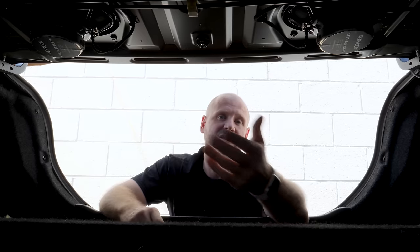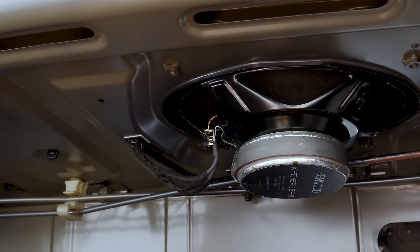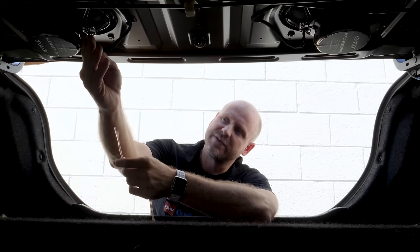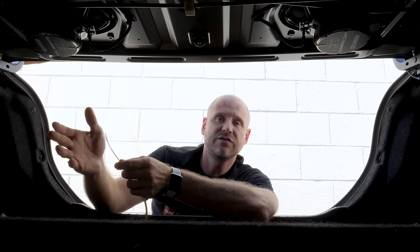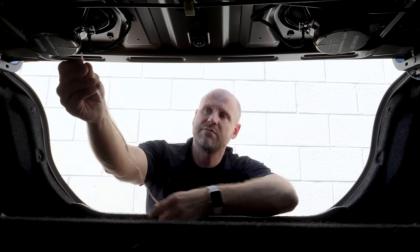The connection to a line output converter is simple. All you gotta do is take the speaker level outputs to the inputs of the line output converter and you're done. Since we've already gone ahead and replaced James's speakers, we're gonna just mimic the installation. Since we've identified our positive and negative leads, which is something you will need to do either by looking up a schematic or testing for polarity, we'll just go ahead and make our connection.